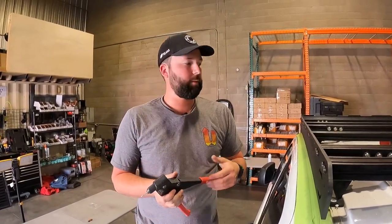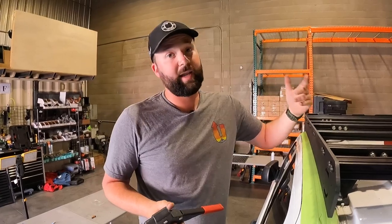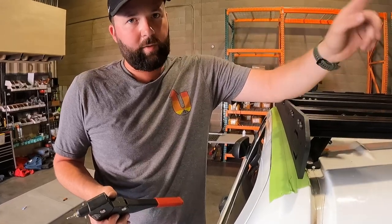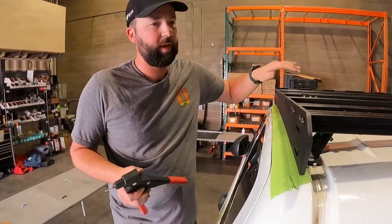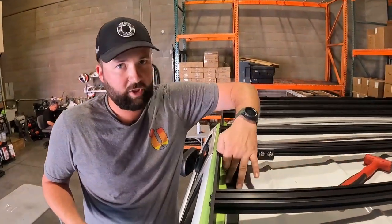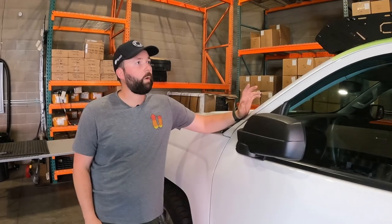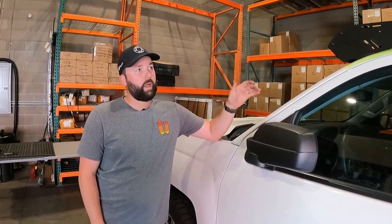All rivets are in the roof — six per side, two per foot, twelve total. Now we'll work on side-to-side adjustment and vertical adjustment, and then we are complete. Use a tape measure to measure from the outside edge of the foot to the inside edge of the Groovetech — you have to do this per bar. Whatever that measurement is, it needs to be identical on the opposite side — within a sixteenth of an inch. Once the spacing is exactly even, tighten those down.